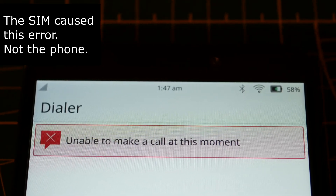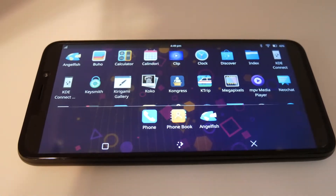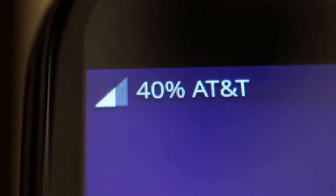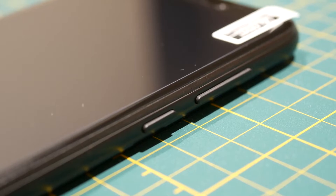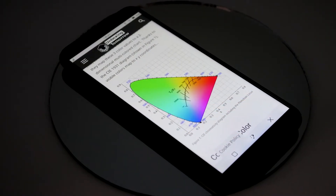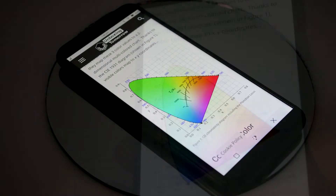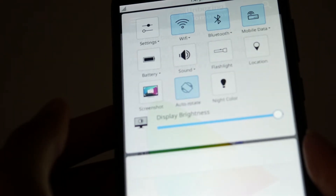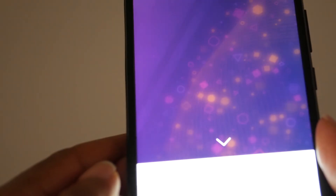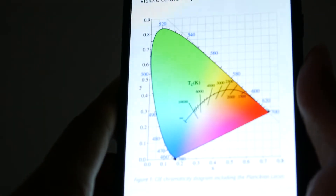If there's any trouble with your wireless carrier, this is where you're going to see an error message, and in my case it does take a couple of minutes for the internet connection to stabilize. Swiping down from the top of the screen will reveal additional options, and if you need to shut down or reboot, you can do so by holding the power button for a few seconds, or hold it down for an extended period for a hard shutdown. In my case, this was almost as far as I was able to get, because while I was connected to Wi-Fi, I encountered a bug that would cause the lock screen to appear practically any time I touched the screen. The pin was accepted every single time, but the screen would lock again, and the only solution that worked for me was to either get out of range of my wireless network or access the phone remotely over SecureShell.